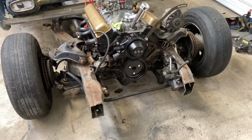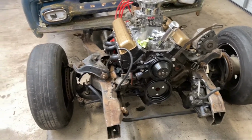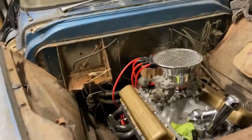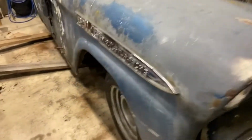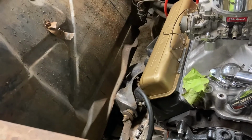So there they are, cut off. Left them just a little long. Trim them back to exactly where I want them. Build new rad mounts and fender mounts off of the front there. But that gives us a good place to start from. Just start cutting some stuff out. Right now, that front end is literally just sitting on top of these control arms, all up super high. And you can see right there, that upper control arm is just in the way.